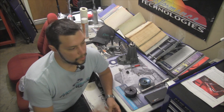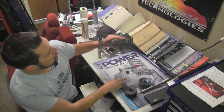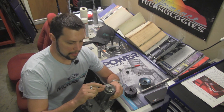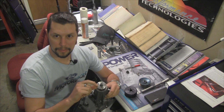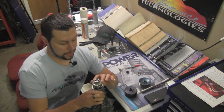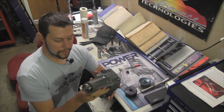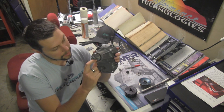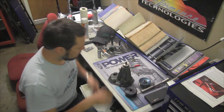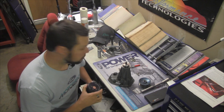I ended up needing to use a hydraulic press to get the hub on the supercharger snout. It was pretty easy — I was actually able to get this hub on about a third of the way just by pushing it on, and then used that as a good spacer and was able to press it down onto the shaft. Everything spins freely, looks great, lines up perfectly where it flares out. So I'm very happy with this. Now that I've got that on there, we can go ahead and stick the beautiful ZZ Performance pulley onto the supercharger.